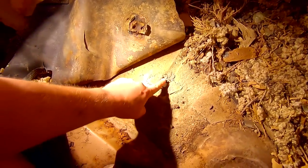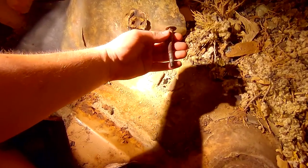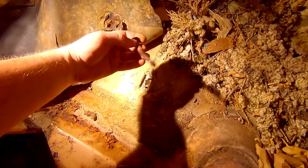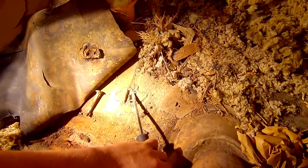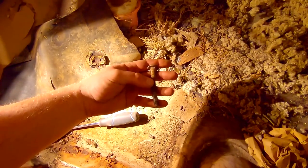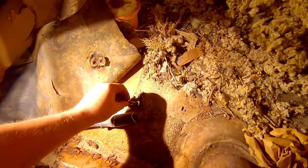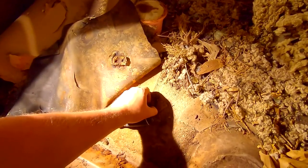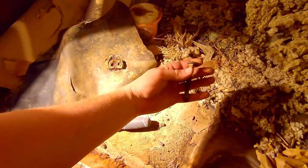I'll show you guys how to do this on a 59. On the 59-60, there are these two little tangs right here, and you have a carriage bolt — you guys can see how curved that thing is. Normally it just sits down in there; once it sits flush, you beat those tangs over the bolt so it doesn't spin, and you put your gas tank in. All you have to do is grab a trusty screwdriver or a punch and knock those back. There'll be a stopper nut up on top — take that loose as well as the initial nut. Take the two tangs off, lift up the carpet — it's a vinyl floor mat, which got ruined, just so dry and brittle. Take it right out and get a fresh one.